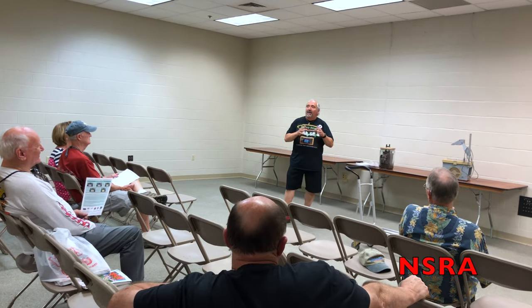Expense of its age. It's not going to last as long if you gas a battery like that. But the biggest thing that I relate to is it's a heart attack for a battery. I mean, it really is. So if you want a battery to last longer, you simply don't jump them. If you jump them, you will shorten its life by at least a year.